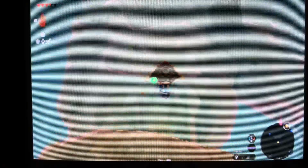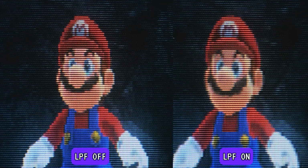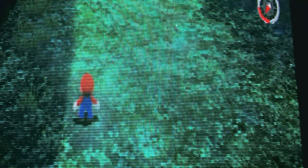3D games don't necessarily need the overscanning pixel mapping option, as broad vertical bumps mostly go unnoticed in these colorful and complex environments. A 480i output would be great in downscaling this type of content, but the low pass filter makes it much more acceptable, and it's a feature that I hope we could see implemented on other scalers.